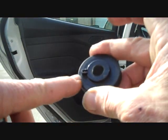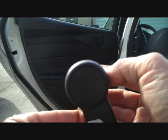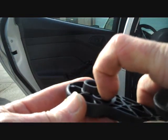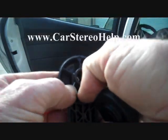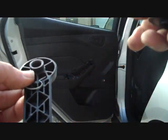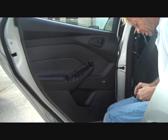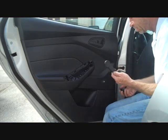This panel has a little key on it, so when it fits back on the door panel it goes on this way, and then this panel will go back on and snap right back on. What you're trying to do is get between these two panels, find this clip right here, put your pick tool into the edge of it, and pull it away so that it releases the two locks. This does take a little bit of pressure. I do suggest — don't do this over the grass. Many times that clip will pop to the ground, and without that clip this is not going back on and staying.